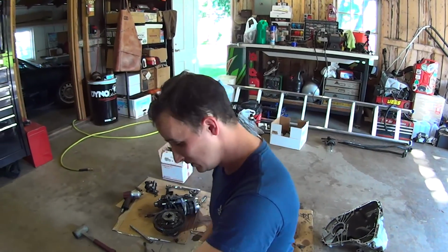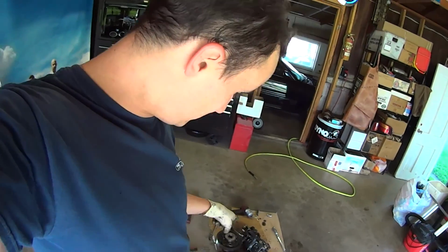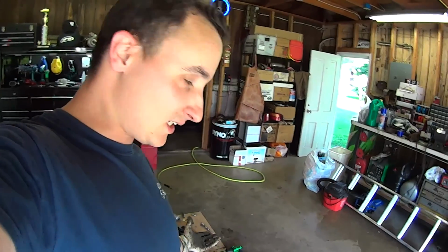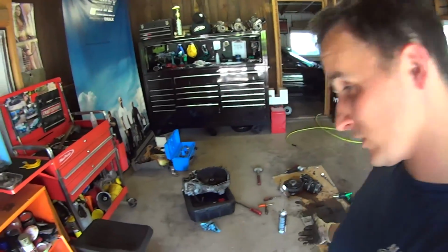Transmission had all sorts of problems. Okay, we'll take that apart too. So then there's the magnet with all the metal shavings on it. I've got an input shaft bearing, but I don't have bearings for the differential, so I'm going to clean up so I can get the Camaro back in here, and I'm going to order some new bearings for my diff. I'll probably press those on at work, and we'll just have to cut this one short, because I don't know that I can go much farther than this. So with that said, I guess I'll talk to you guys later. I gotta order parts.